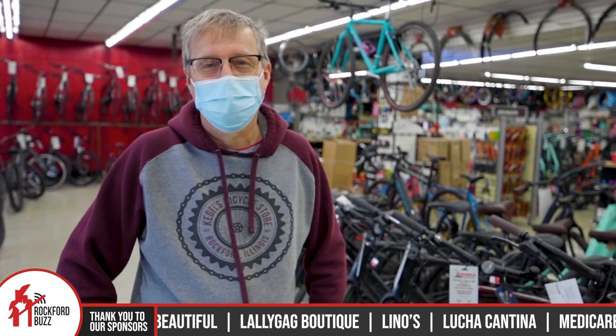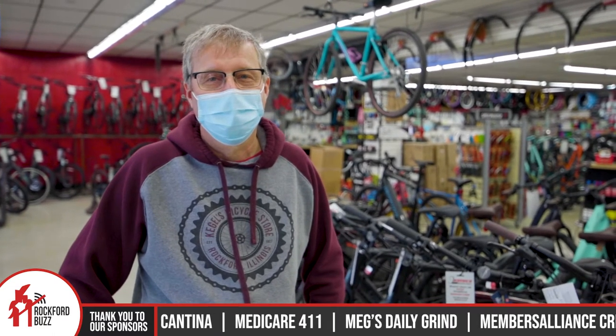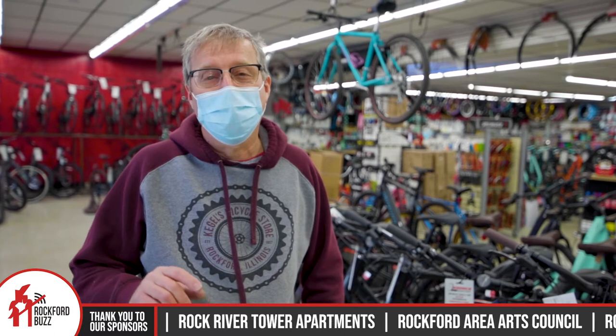So with the new season rolling in here with spring, what are some things that people can do to prepare their bikes if they already have some to get ready for riding season? The main thing, if you've got a current bike and you're going to go out for the spring for the first time, is air your tires. We're always shocked how many people come in with two pounds of air in their tires where they need between 35 and 70, depending on the bike. On the side of the tire it will also say what the PSI should be — the pressure you should have in your wheel.